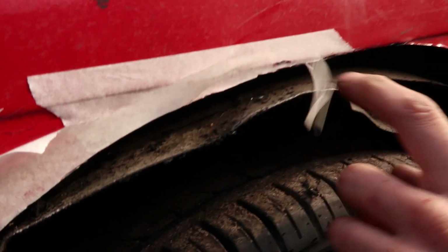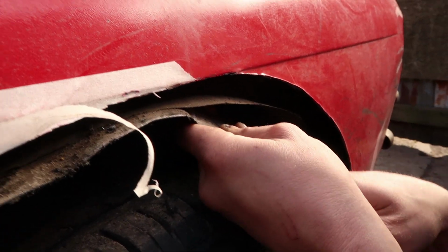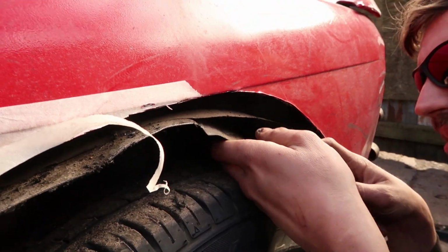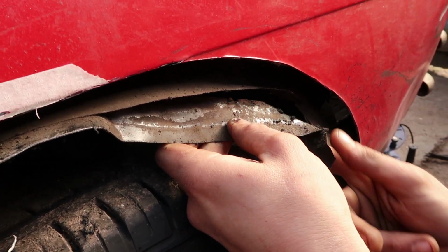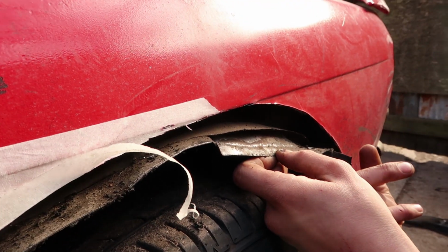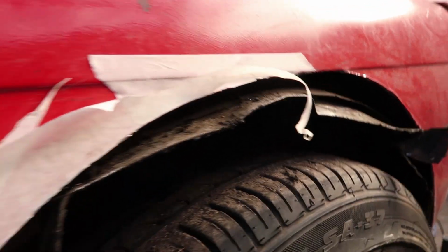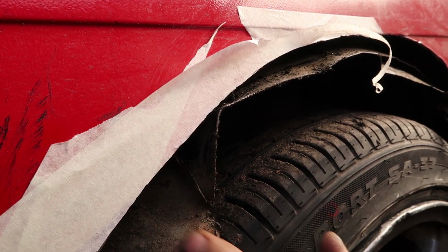So it's just welded along that piece, and the weld's obviously given up, or the seam, whatever, probably seamed with a couple of spot welds. There's the spot weld there. Yeah, they've obviously given way with all the heat that builds up there. There was another spot weld there. So maybe, unless that was done when they rolled your arches, because that does not look original to me. But look, them spot welds, they're not original. This has been cut out before, bro.